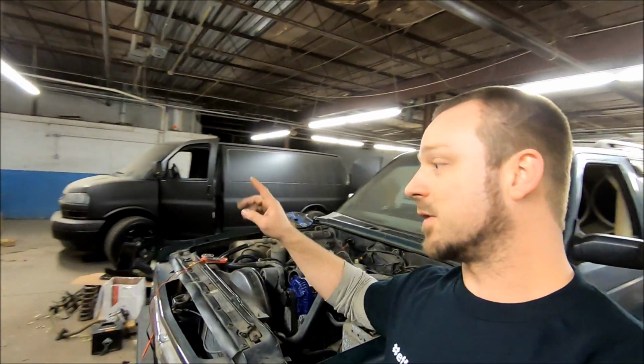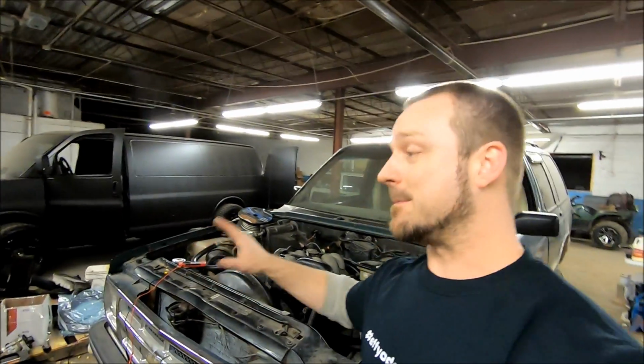Well, power that's coming from any batteries you got up there, power that's coming from any alternators you got up here. So if you're one of these guys that's got a huge aftermarket alternator setup, you got 4 alternators on your car, well, each of them alternators is a power source, so that would be 4 runs of wire plus my factory battery. I would run 5 positive runs of wire, and that's it. I'm not a believer of having 10, 12, 20 runs of wire. It's not needed. It flat out is not needed.